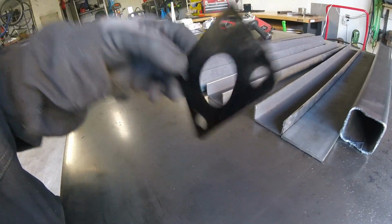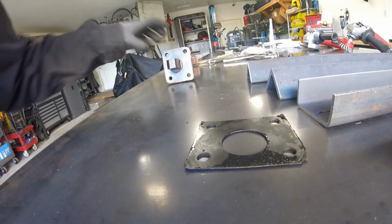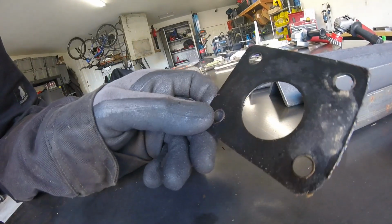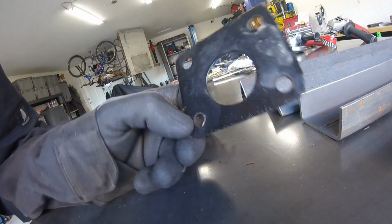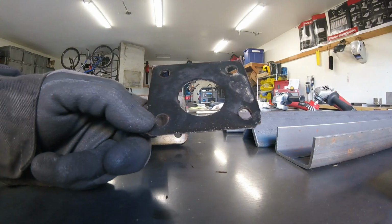So I don't know if you guys can tell from the light there, but I just pulled the gasket off. And you can see for some reason it's leaking out the bottom of this paper gasket. Now, whether it's because the bolts on this weren't tight or whatever the case may be, there's a very simple solution for this. We just basically use some 1-minute RTV on it, and the dang thing will never leak again, nor will it ever think about leaking again. So I think that's what I'm going to use for a solution.